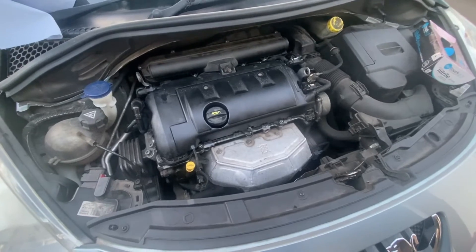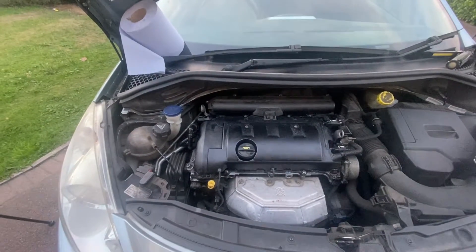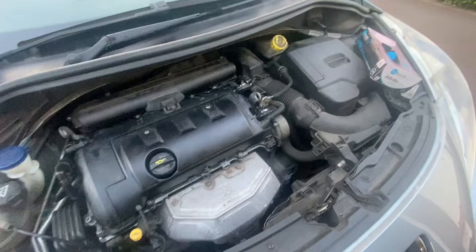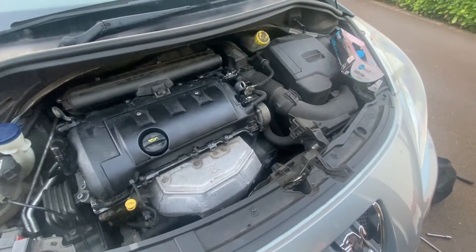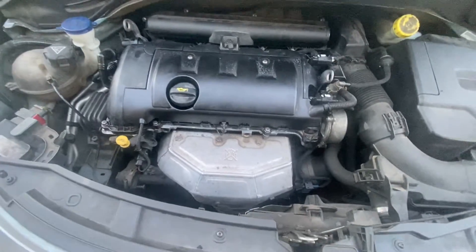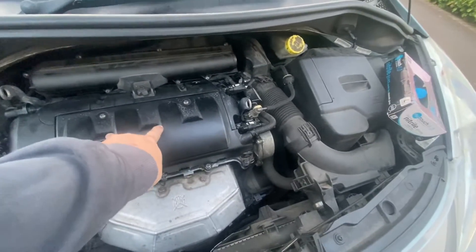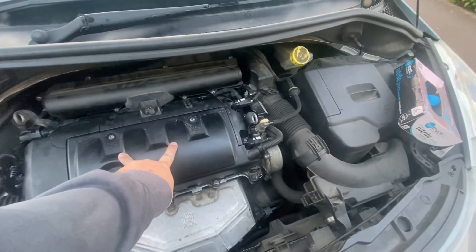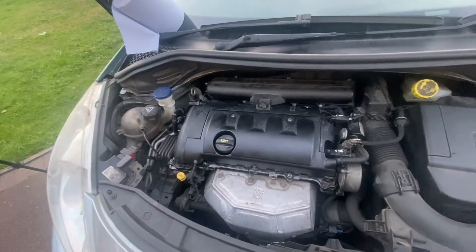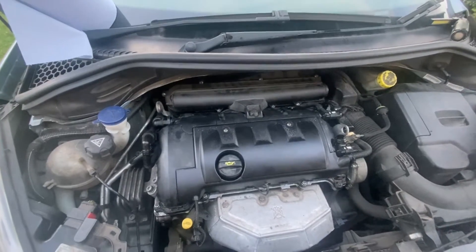And there we go, back together. Do you want to fire it up? We need the oil warm to drop it. Yeah, we're going to start it up in a second. It's all back together. What we found is that the two bolts inside had two gaskets on them. Dave's theory is that the gap was causing not everything to seal properly — that's why we were getting oil into where the spark plugs were. So yeah, we'll see how it goes.